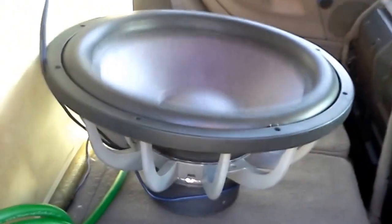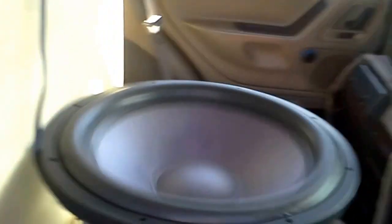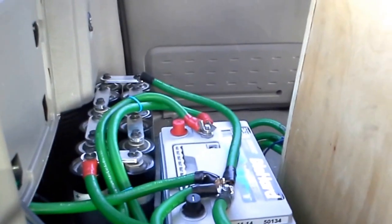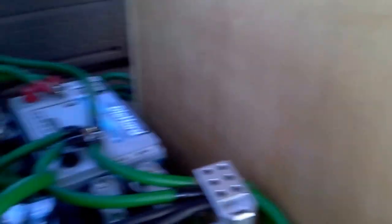Running this Aria Audio SX18 with a 2-ohm PSI 1500 watt recone kit. Spray painted the cone with multi-color purple glitter paint. Running one DieHard Platinum Group 34 marine battery and one DieHard Advanced Gold Group 65 under the hood, plus 18 Maxwell 2600 Farad supercapacitors wired in series-parallel — total of 1299 Farads — off of a Crescendo BC 3500D wired at 1 ohm.